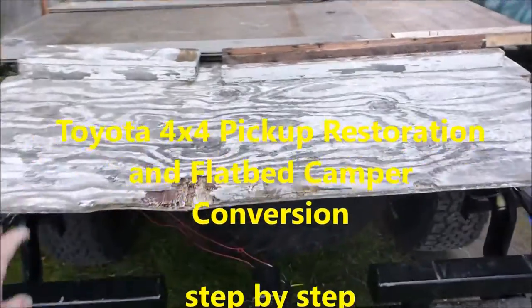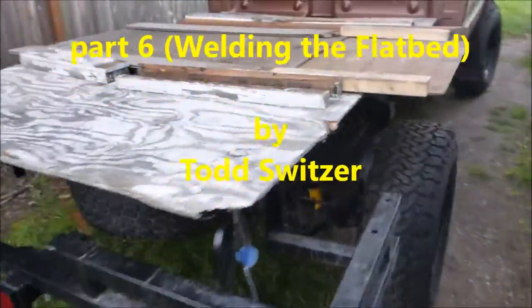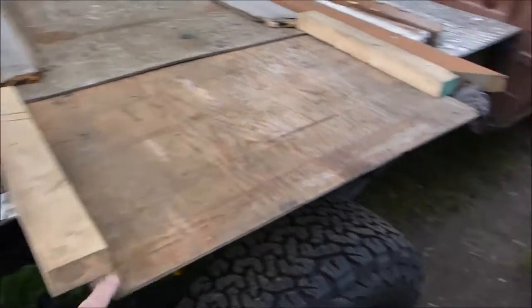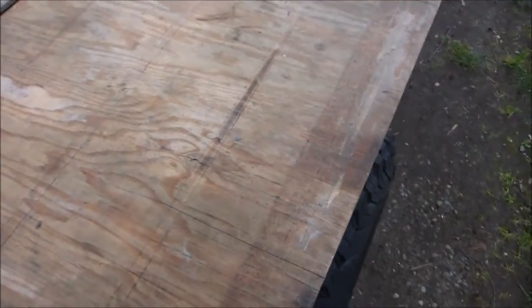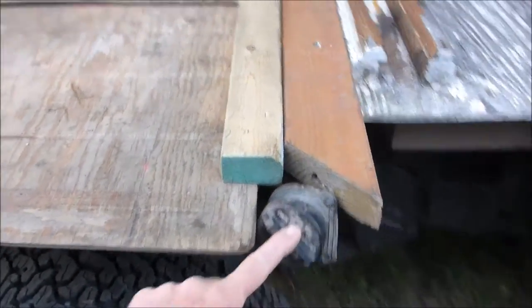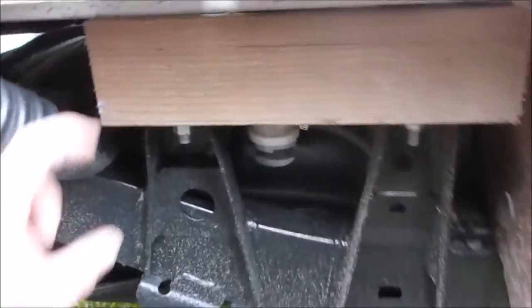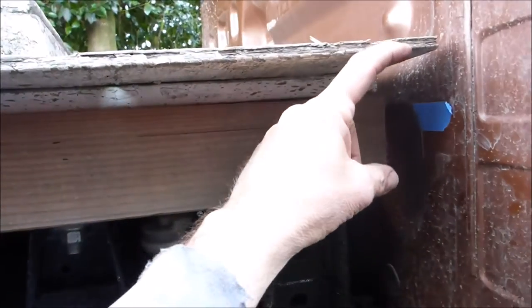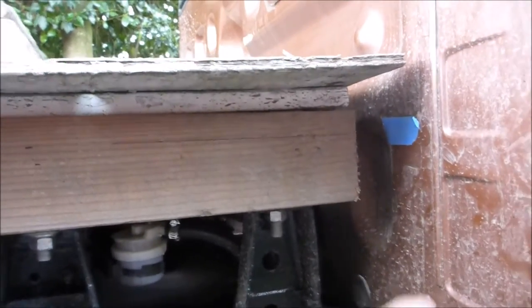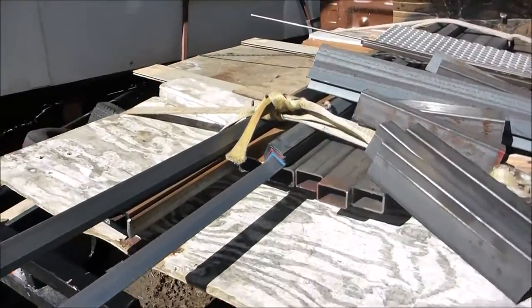Here's a template — this is actually the board off the original roof board rack system, with some extra boards put out so I could judge the edge of the tire, get the entire distance across the fuel tank, where it hangs, to get the proper angle on the intake hose, the proper amount of block-up to clear the top of the fuel tank, and basically get the right materials to line up. Put a mark on the truck, take this board off, and work with the steel.